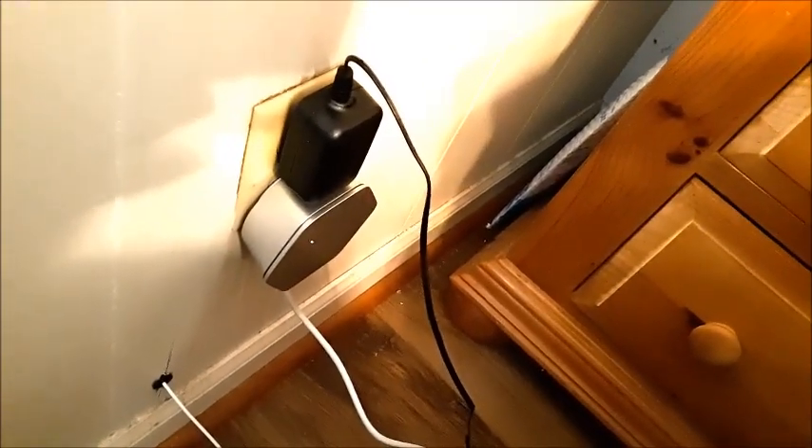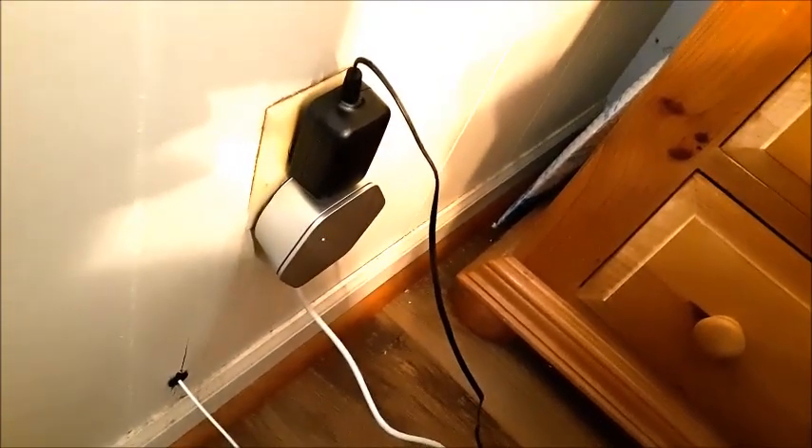Let's go back to where our router is, plug the internet back into the router, go ahead and plug back our antenna and power, and give that a good five minutes to see if we're getting a connection. That should fix the problem.